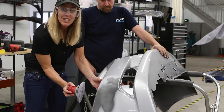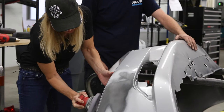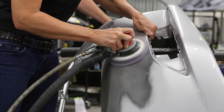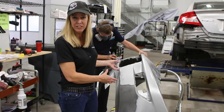We've got aluminum oxide sandpaper — it's a 120 grit — and this takes off the first layer and gets it flush. As you can see, that little scratch is turning into a lot of repair area. What we're doing now is sanding out the rest of the bumper where there's some stone chips and stuff. There's no point in making just one part look like a million bucks.